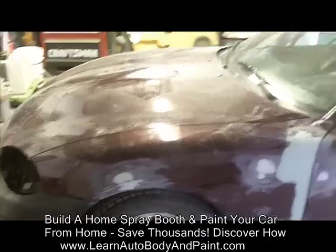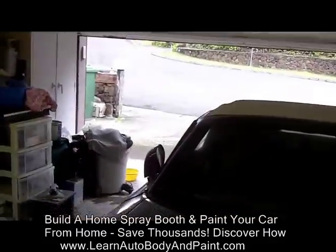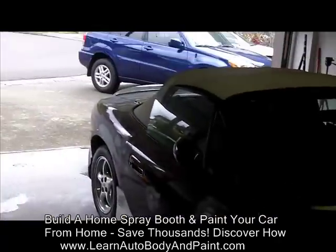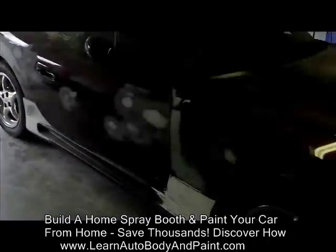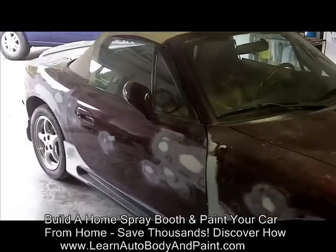But as far as stretching out, doing door jambs, clear coat, base coat, candy, all of that, you're not going to do it in a home garage anyway because of the fumes. Now, it all depends on where you live and how your neighbors are also. My neighbors aren't that bad. They don't complain when I do little touch-ups, like I'll do a fender or something from home. But when I'm doing completes, I like to do it at the shop. Okay, so it's best if you could rent a booth.